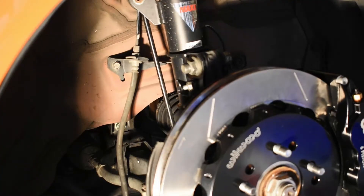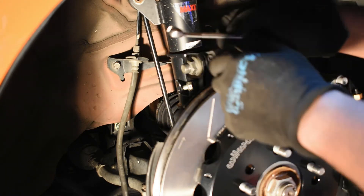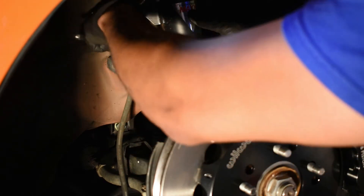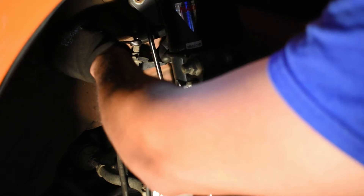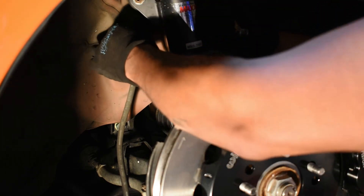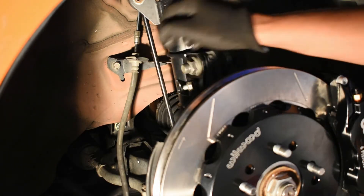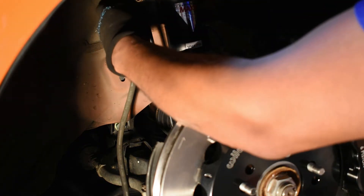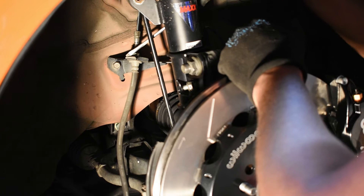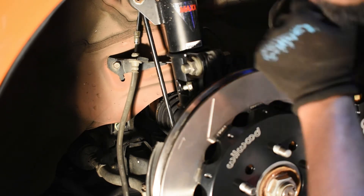When you get to about page five of the installation instructions, you find out that you need the Wilwood brake line — they say it's recommended, but in reality you need it. To get the OEM brake line off, you need a crow's foot wrench, which grabs brake lines almost like a socket with more points of contact so you don't strip them. Then you take the clip off — the best way I found is a flathead screwdriver to slide them out. A slightly thicker screwdriver would have been better, but once you get some grip it slides right out, and then the brake line comes off.